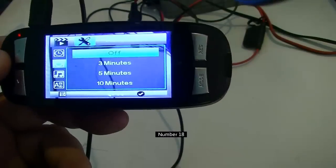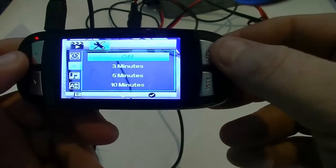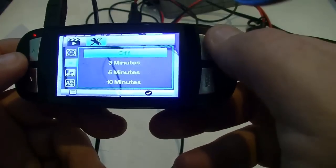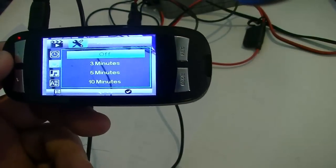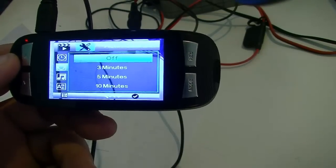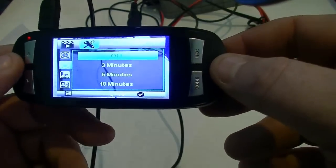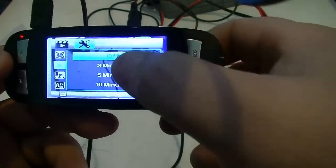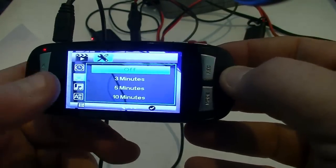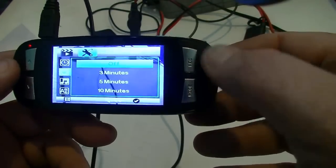Auto power off: once the power has been cut to the camera, it will continue to record for the preset amount of time before shutting down. I don't use it because when I unplug my camera the batteries are so depleted the camera just shuts off anyway. If you have a capacitor you might have options of 1, 3, and 5 minutes. If you have a battery it could be 1, 3, and 5 as well. The batteries might not handle the requested time and shut off mid-recording, which again will corrupt the last file. Mine is set to off.